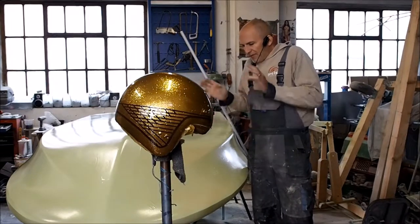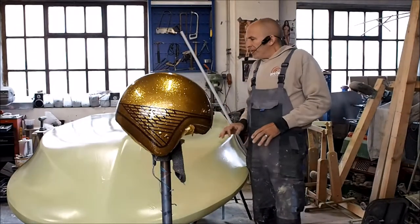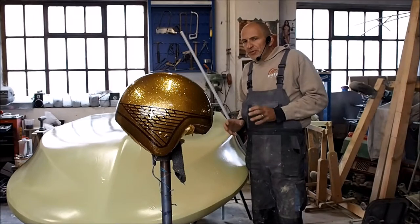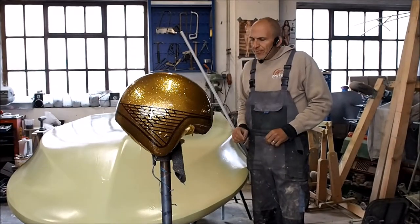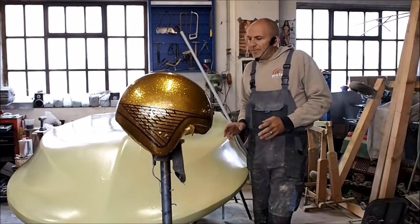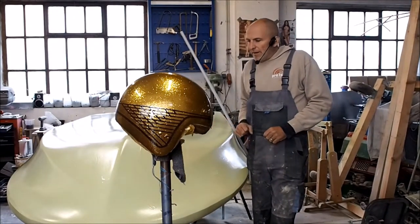The boat was sanded and fed with putty and fairing and sanding, and I'm just sparing you all of this. You've seen it on the top side. As you can see, it's two coats of epoxy primer on it, so it gets a last bit of sanding because we put it on pretty thick. There's a couple of runners which I need to fix, and then she'll get the first coat of paint. The color will not be that much of a difference because it's an ivory beige tone that goes on the bottom, which is pretty similar to what the epoxy looks like.